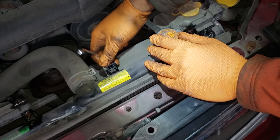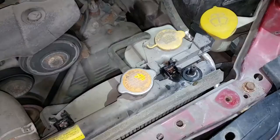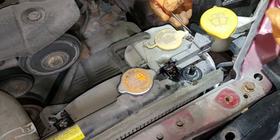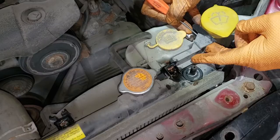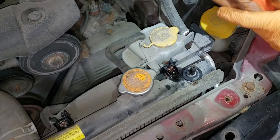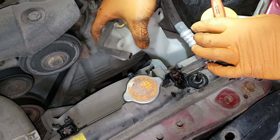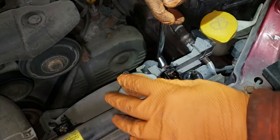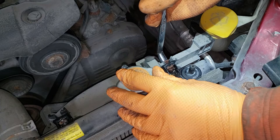The other side wasn't so nice. Now that we have that bolt out of the way, the last bolt is blocked by the overflow tank. You'll need to get a flat screwdriver to push this tab back, then push the overflow bottle towards the engine and wiggle it out. Grab the hose up top and wiggle it loose, then you can wiggle the overflow tank out. Be sure to drain whatever coolant is left in there and replace it with brand new coolant. With the overflow tank out of the way, go ahead and attempt getting rid of this bolt — hopefully it doesn't break.